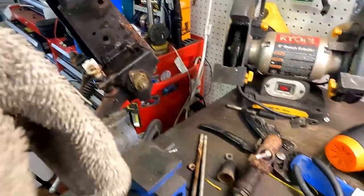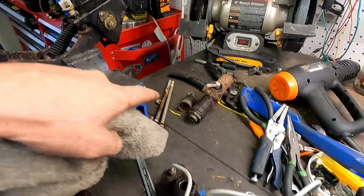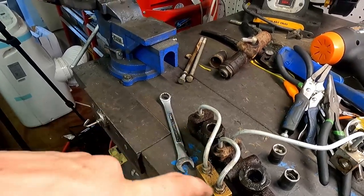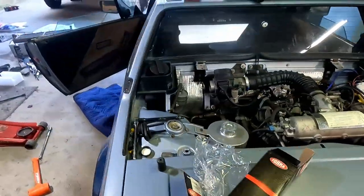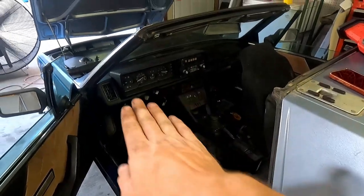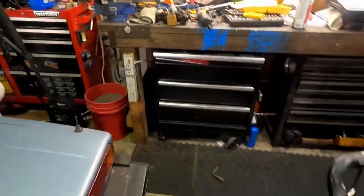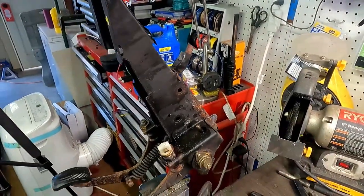And then we'll slap on our new master cylinder and clutch master cylinder and transfer over all these lines. I'll also run the brake clean through these lines when we take it off to make sure they're full and clear on these distribution blocks. And we'll probably go back into the car on this side, go up through those hoses and just blow a little bit of air, like out of a keyboard cleaner duster, up through the line and make sure that's all clear as well, so we don't have any obstructions. So let's get rid of all this rust, clean it up, and make it look nice and new again.